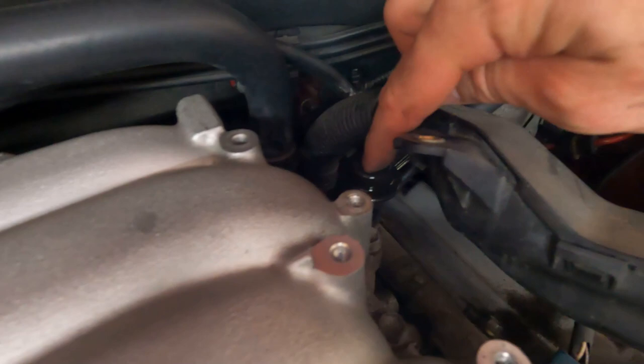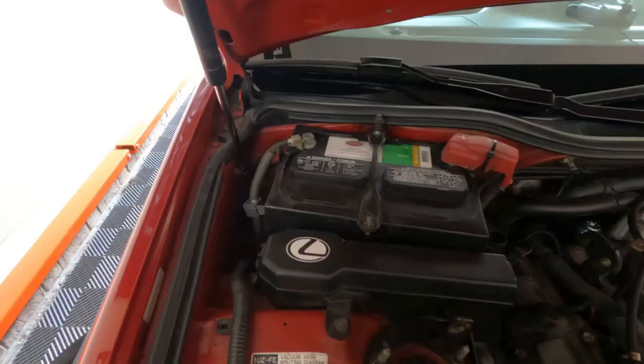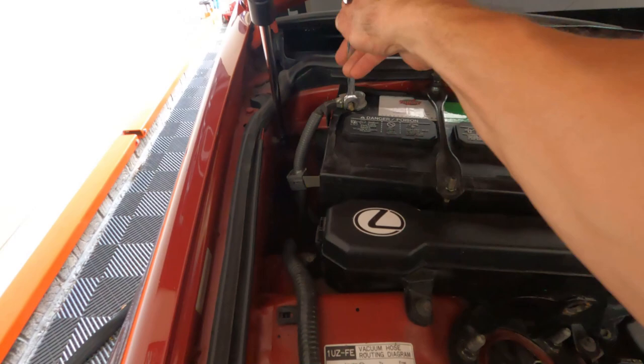Here's the damper — as you can see it's wet, and that is because there's a screw missing from the top of that damper. It is weeping fuel and that's what is causing the smell.